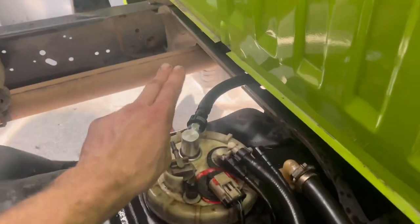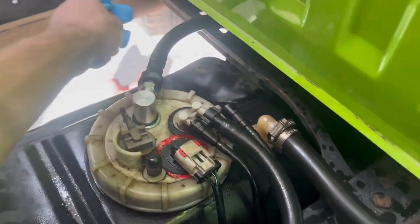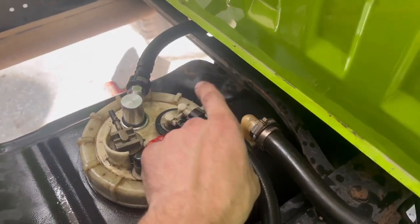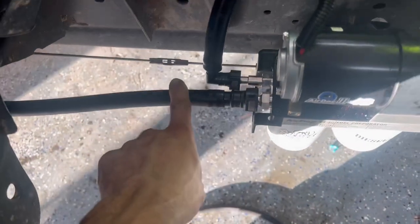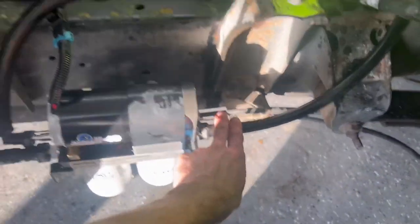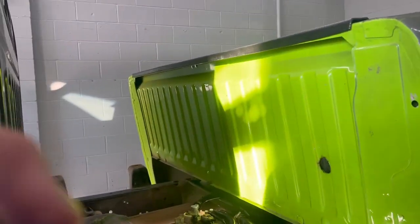The time-lapse you just saw was us installing the draw tube on this, which is pretty self-explanatory through the directions. On this kit, the factory feed line turns into your return — so you modify that, and your factory feed line becomes your return. This goes to the engine, this goes to the return into the tank, and this pumps the fuel out of the tank into the VP — or into the fuel system and sent to the VP. Very, very clean install. Let's get the bed pushed back forward and see how she runs.